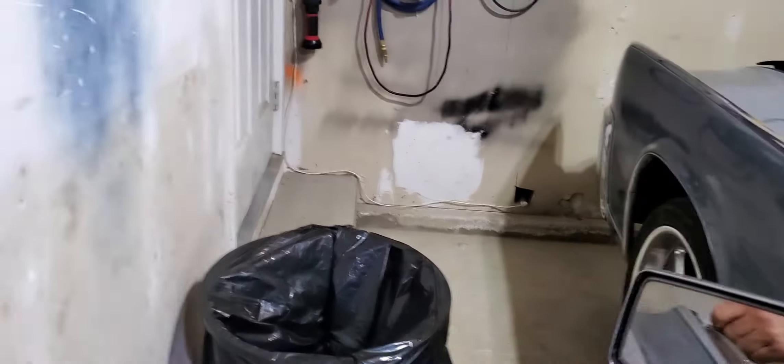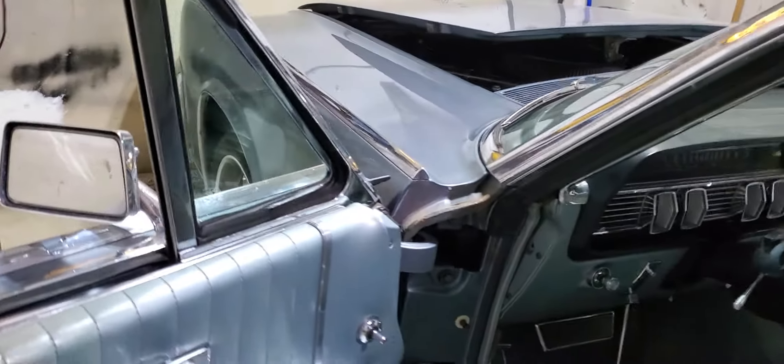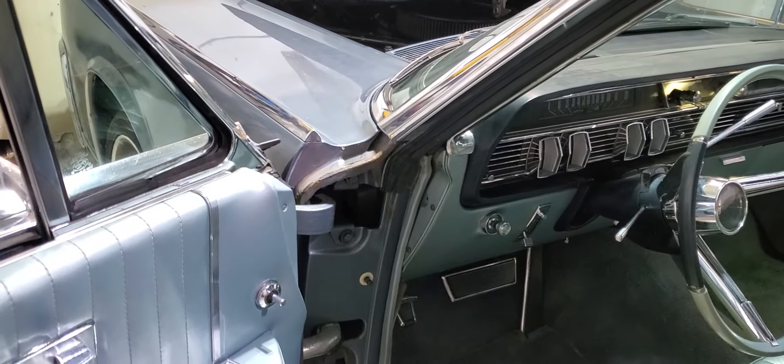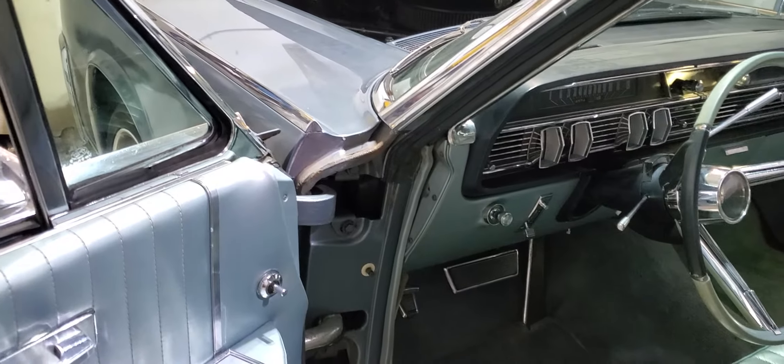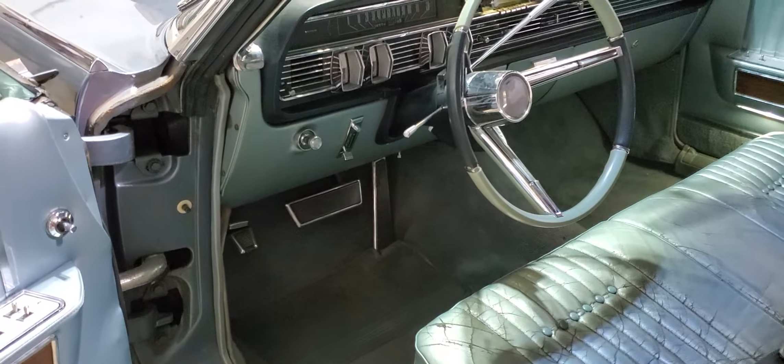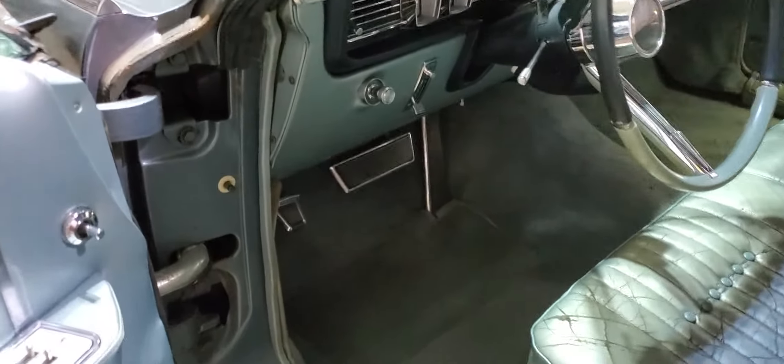I found a Delco one that works, but I was using that for a couple of weeks and now it has also died. I suspect that Delco one just doesn't handle the hydraulic pressure that disc brakes generate. So what I've done is gone to a style of switch not dissimilar to a modern vehicle.